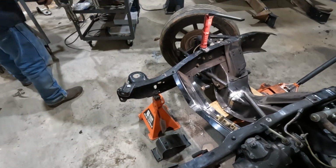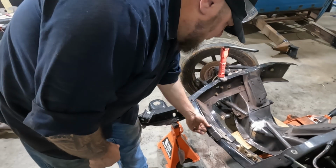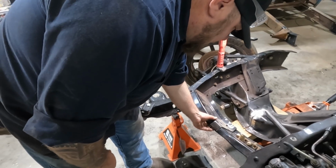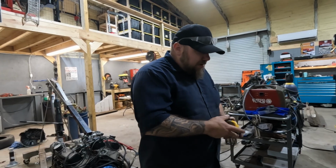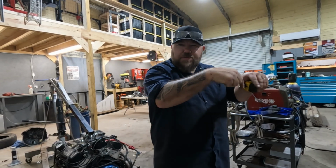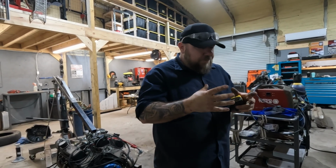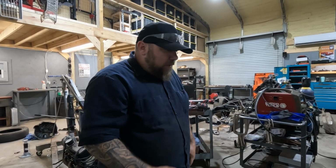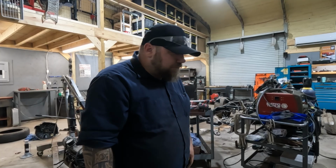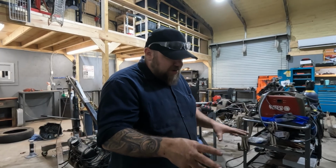But I have the piece that I took out. We can clean this up, clamp it in, weld that all together, and then fill this Grand Canyon on this side. I don't think it'll be that big of a deal. A couple different ways I was thinking about doing this. I thought about drilling some holes and putting a strip of metal inside, and then plug welding that strip to reinforce it, because that's going to be stronger than just a solid bead or just a butt weld. And it would look a lot cleaner, but I think we're going to end up fish plating the outside.